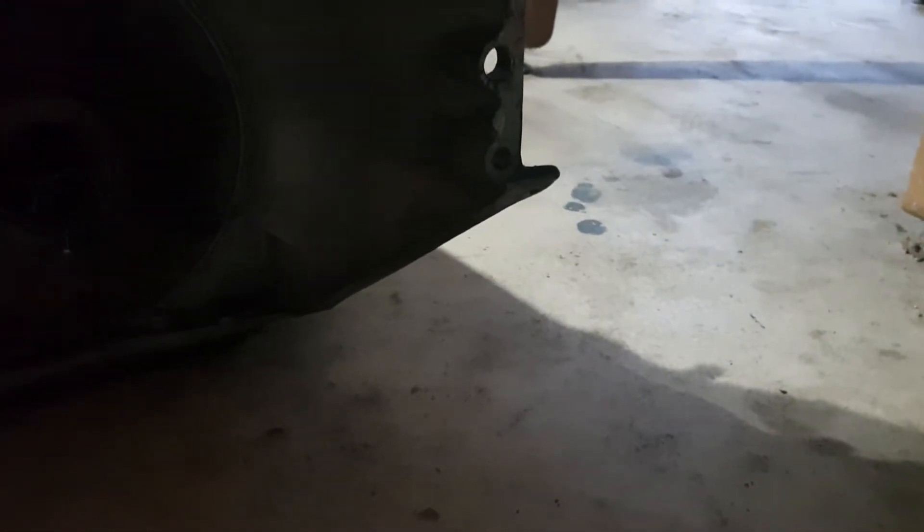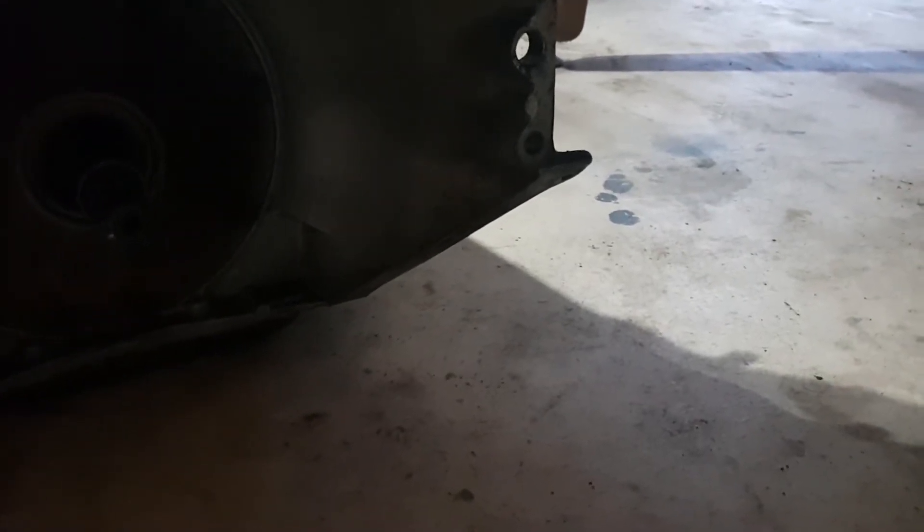Right there — somebody welded that tag. See, on this side, somebody cracked the case and welded it up, which is actually pretty interesting. But I'm not worried about it; it looks like a really solid repair with no big issues. There's a bit of play in the rear shaft — I think we could replace the rear bushing — but overall it looks like a pretty good transmission.